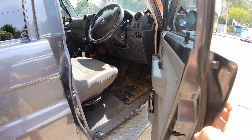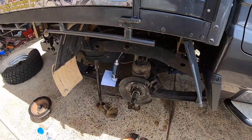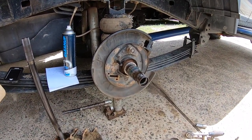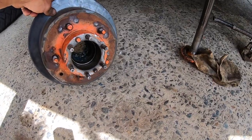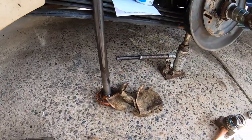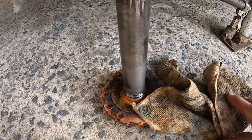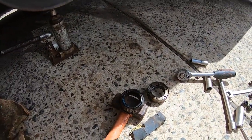All I knew is I got to the bottom and my brakes were hot. I expected to take this all apart and see mud in there on the reluctor, but that's not the case. The bearings are in okay condition — not great — there are signs of salt water from the trip we do twice a year, a bit of rust on the back of the axle flange, but they're in okay condition and there was no play in them.